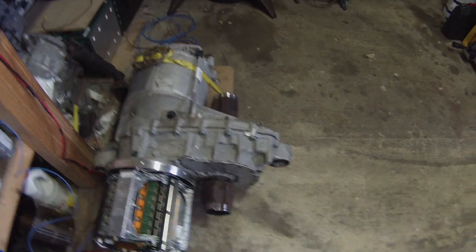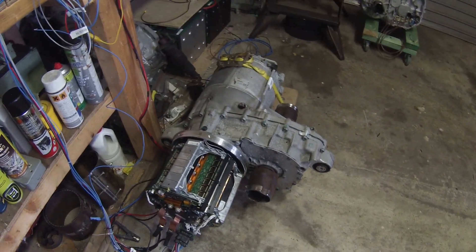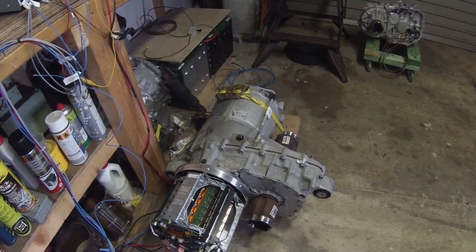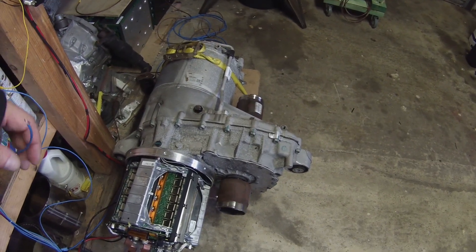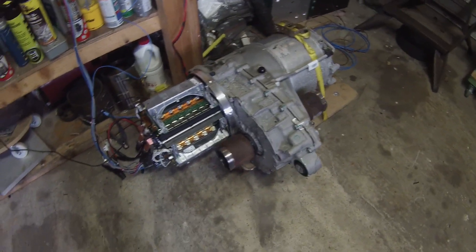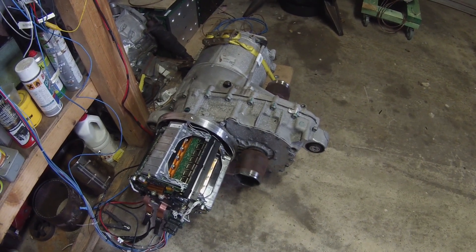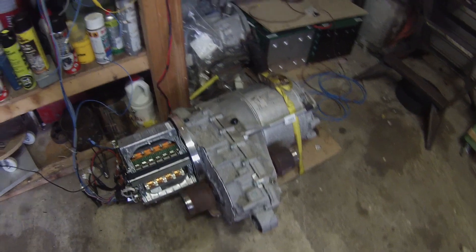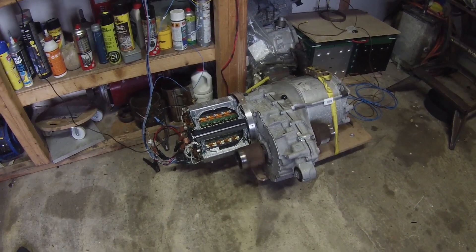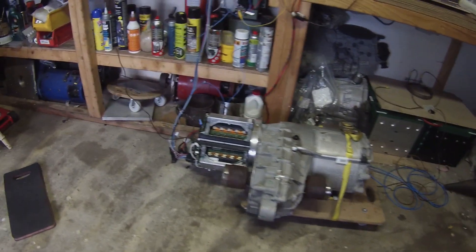If we then put the brakes back on, we'll basically brake the motor to a standstill. Keeping in mind that I've got regen turned off here because we're running from a power supply. If we release the brakes again, we go into creep mode — creeping forward — and I can then bring on throttle and we can accelerate up to whatever speed we want to be at. We would then be regening back down, but obviously we're not doing that now. The next thing in the nice-to-have category is cruise control.